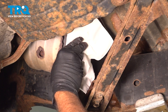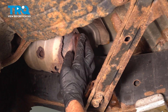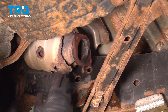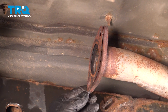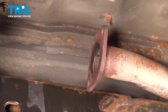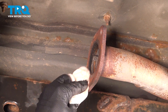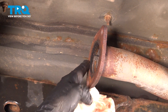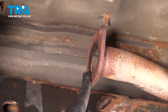I'm going to inspect the flange on the cat pipe here. Make sure there's no gasket, make sure it's not corroded, and make sure it has a nice smooth surface — ours does. Let's go ahead to the back pipe here — we have a remainder of a gasket sitting here, go ahead and pop that off. Do the same thing: inspect the flange and make sure it's smooth and not corroded. If you do have corroded flanges, you want to go ahead and repair it or replace the back pipe or whatever you need to do.